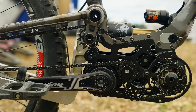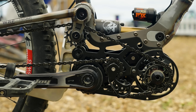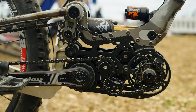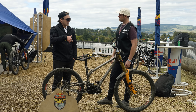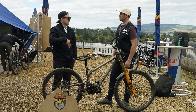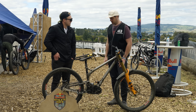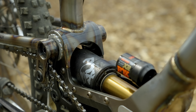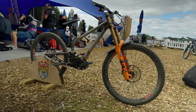By having a tensioner on an unsprung member, that tension goes wild. But as soon as the tensioner is off the mainframe — which is a sprung member — all the tensioner is doing is taking the tension of the chain growth. It's not interrupted by the movement of the rear wheel going up and down. The main thing I noticed was just how quiet the chain was because it was tensioned off the mainframe.